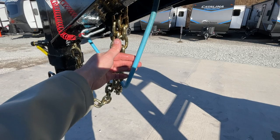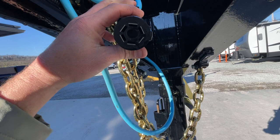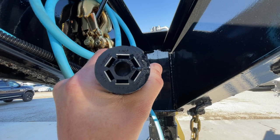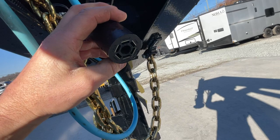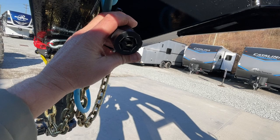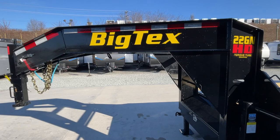The safety chains come with a blue harness — a cold weather rated harness that stays flexible down to negative 65 degrees. One detail I really like is at the end of the plug it's color-coded by position, so instead of having to probe and find the position, it shows you the color and location. In the trailer industry there's no standardized wiring colors, so this color-coded plug end is a genuinely nice feature that a lot of manufacturers historically have not done.